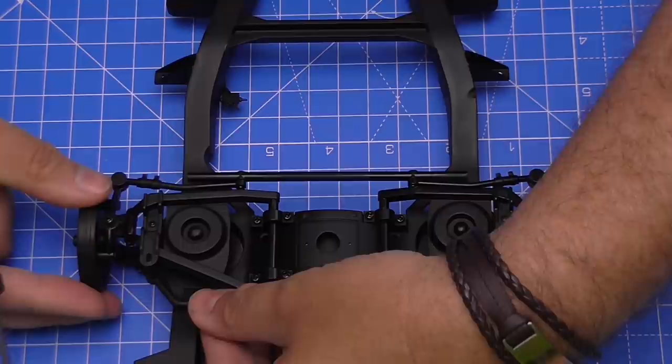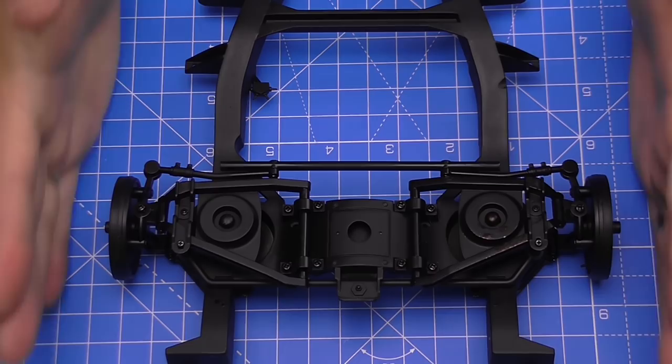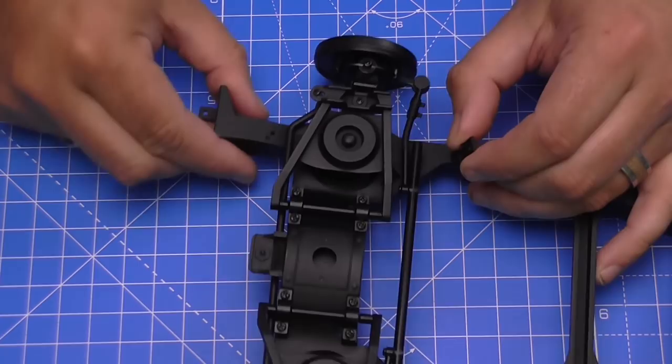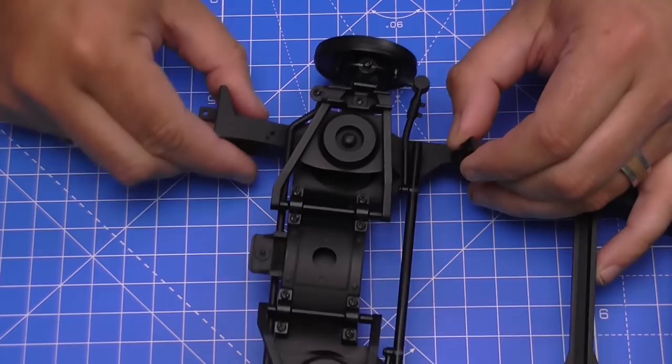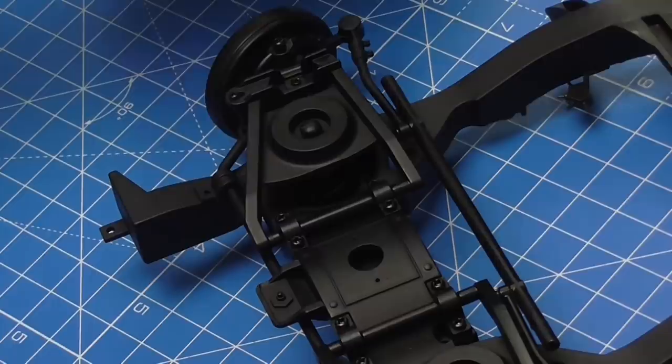We need to make sure the wheels are centered straight. I've made sure the wheel was pointed in the right direction, so we're all ready to put the brackets over the top of this stabilizer bar. The good thing about these brackets is you've got a little lug on there which positions it into these holes. We get the first one in on this side, making sure the lug is on. That's going to be held in place with BM screws - so we are going into metal on this one.